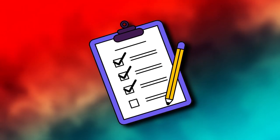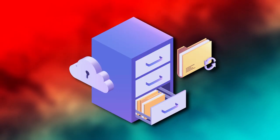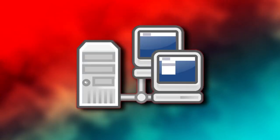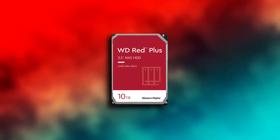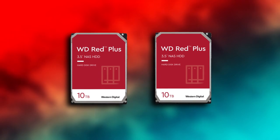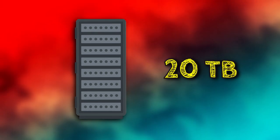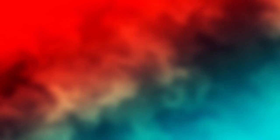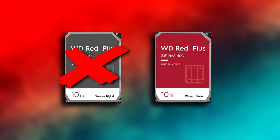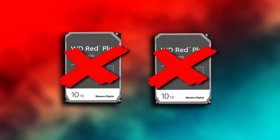I do eventually plan on doing a proper conversion to one of the aforementioned OSes, but for now this will suffice for archiving my work and accessing it from any of my devices at home. And as far as the actual storage itself, I'll be setting up both 10 terabyte drives in a RAID 1 configuration. So instead of having 20 total terabytes of storage, I'll have 10 as data will be copied to both drives simultaneously. In the event of one drive failure, I'll still have my data on the other drive. And if both fail, well, I'd be fucked. But let's not talk about that.